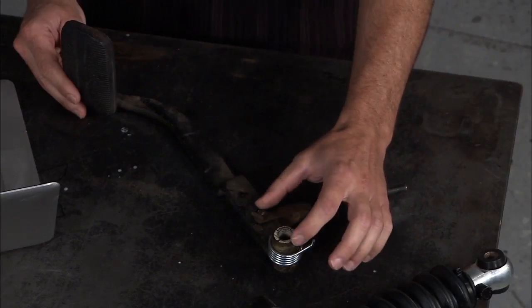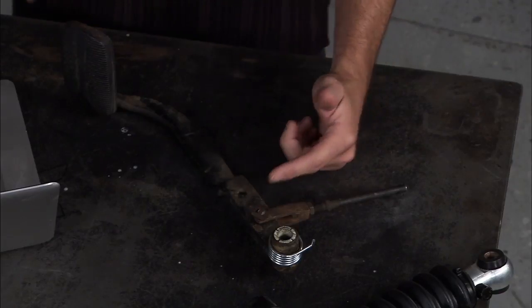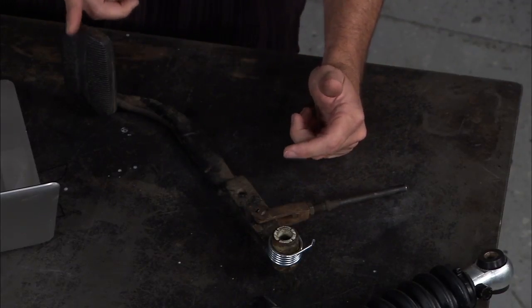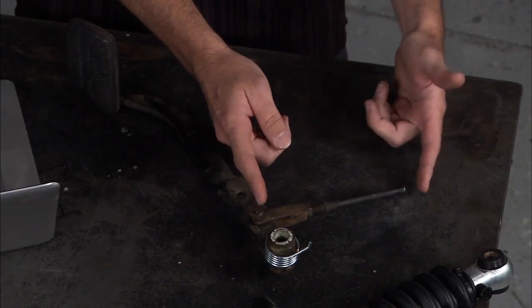You may not have noticed, but there's a difference between a manual pedal and a boosted pedal. If we check out this pedal here, this ratio of this length to this length is going to give you your leverage. So the same foot pressure you put here, you're going to get a multiplication going into your master cylinder and, in this case, your booster.